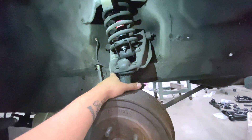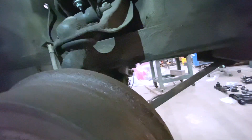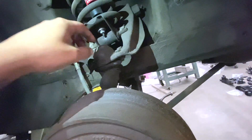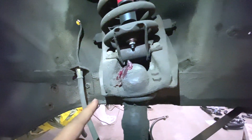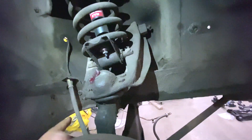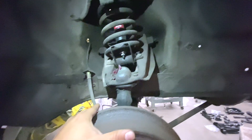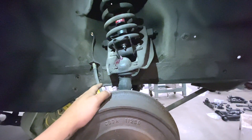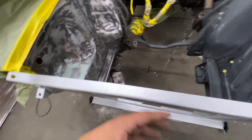We have the wheel off and this is the passenger side suspension. It looks like it has new shocks but the rest of it has seen better days — cracks everywhere. So we're going to go ahead and replace the upper A-arms, the lower arms, all the bushings, ball joints, and so on. Since we're doing the driver side, we might as well do the passenger side too. We're also going to slap on a new set of disc brakes and coilovers, but for right now we're just going to do the full front end rebuild so we can start rolling.